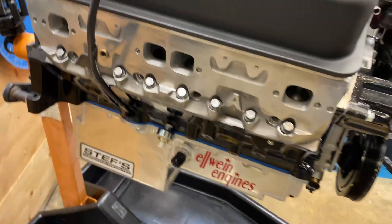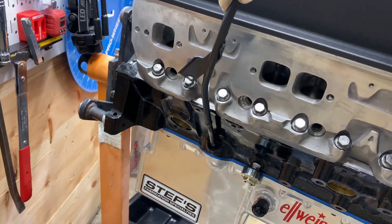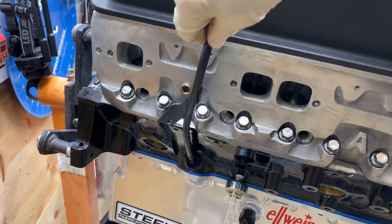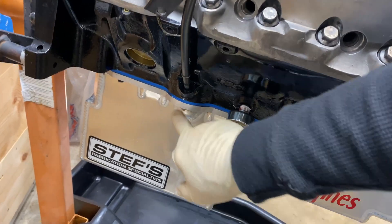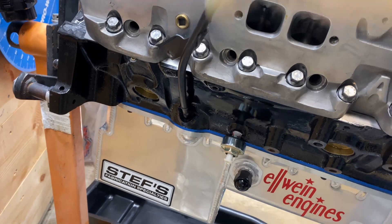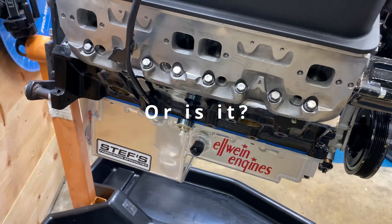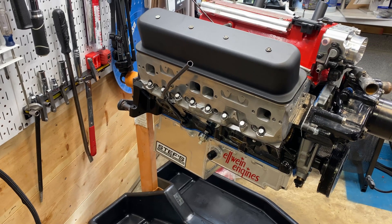Also, whenever there's a custom — I have a Stef's oil pan — you always check before you button everything up. The dipstick will not go all the way; it hits something. I think it's hitting the area in this oil pan where they clearanced it. So I'm going to take the oil pan off and see what we've got. It's not the main caps — I already tested it. These have stock four-bolt main caps, so it's not those. The dipstick should be able to pass through.